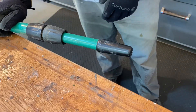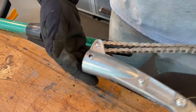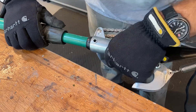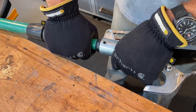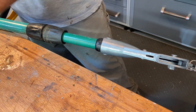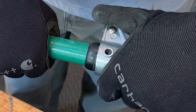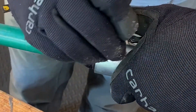Disassembly is done. Now to assemble the new part — I've got the whole assembly intact, nothing required. I just slide that on there. This fits a little looser over that rubber tip, which is odd. It doesn't quite line up with the hole, so I'm going to have to force this bolt through there to pull it down onto the hole. You don't want to bung up the threads while you're doing this — that's an easy way to screw the job up.